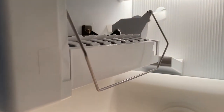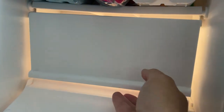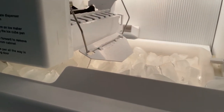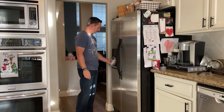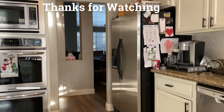Once you've got it in there, just be patient. Let it do its thing and walk away. Close the door so it gets colder in that space and lets the ice freeze faster. Don't sit there watching it the whole time hoping to hear it start — these things work slow. Turns out this thing was working like a champ. I put the flap back on that came with the fridge, which helps guide the ice down into the basin. So there it is — a successful ice maker swap on our workhorse Whirlpool refrigerator. If you enjoyed this project, check out our other projects on Average Joe's Gym's Home Projects, and please like and subscribe for future projects.